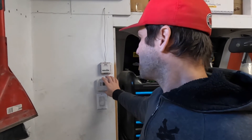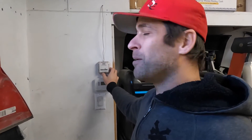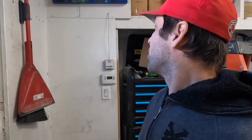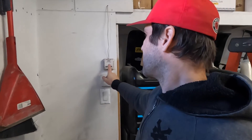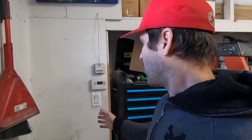I take the controller, bring it in the house, replace the batteries, come back out and notice that even though I have a backup heater it was turned all the way down and so it didn't turn on. It has been cold enough here that some of the pipes froze and I think maybe something inside the water heater froze. It's actually been minus 15 degrees and it's going to minus 20 tomorrow, so I'm gonna have to turn the backup heater on to thaw out all the pipes.